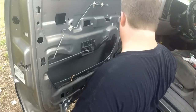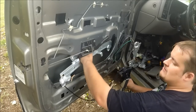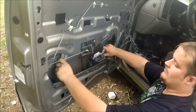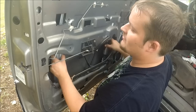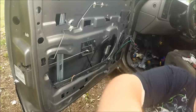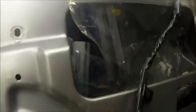Here is the new window regulator. You're just going to kind of twist it in there — do one side first, then the other side. Get the side up, push the right stick up here, and just kind of unfold it. There are little notches that the regulator actually grabs into and holds. Same with this side — right here, you just kind of find it.